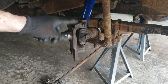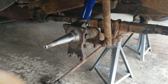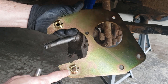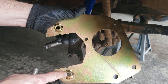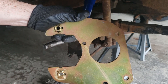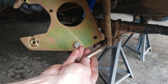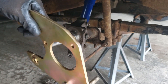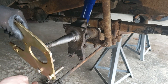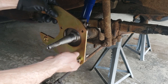The spindle is thoroughly cleaned and ready to go. Next we put on the backing plate. Make sure the nuts are facing outward and the caliper is facing the rear of the car. Use the supplied hardware to mount it — the long bolt goes in the rear — and we also attach the steering arm.